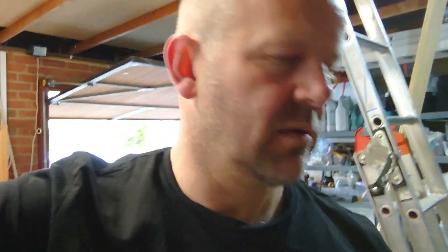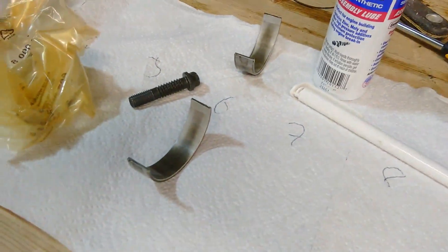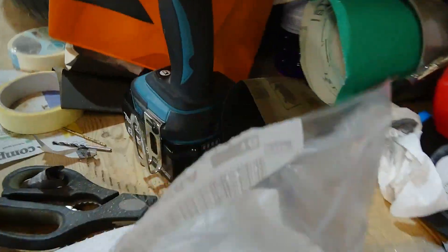It's been a while — it's Easter now. Last time I changed the broken piston, which I've got here as a souvenir. This time I'm going to change the remaining bearing shells. I've got the old shells, a box of new shells, new bolts, etc. I'm going to finish changing those shells out and then get the bottom end buttoned up — hopefully we'll see how far we get.